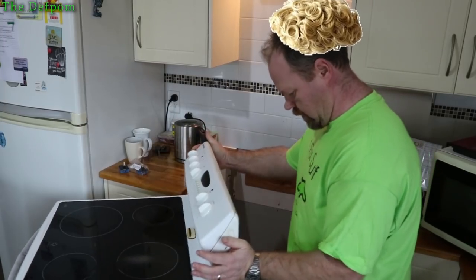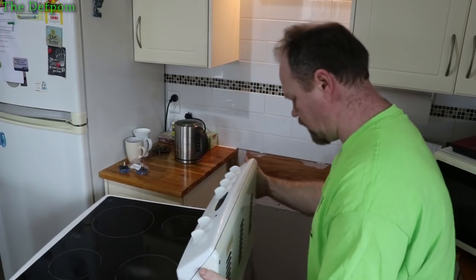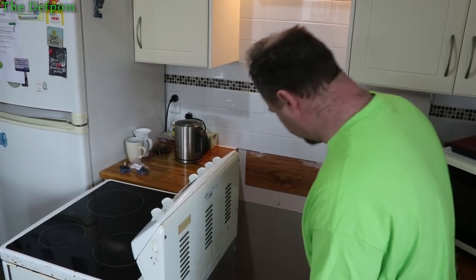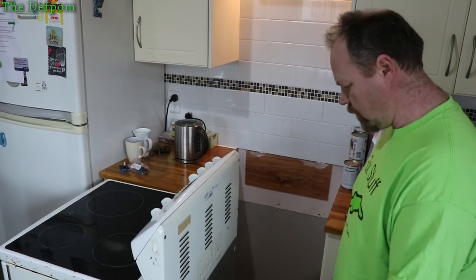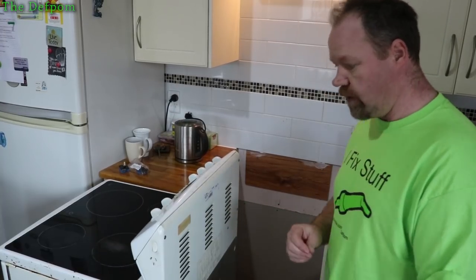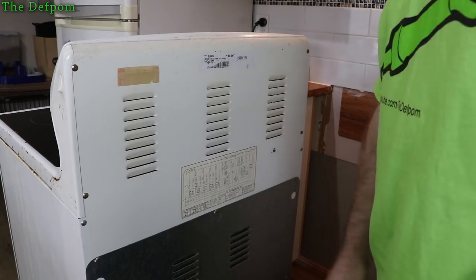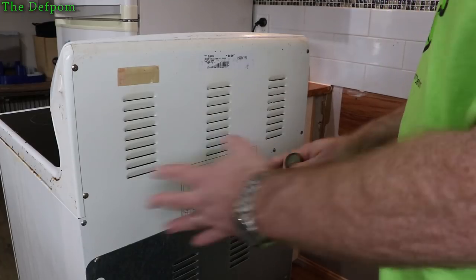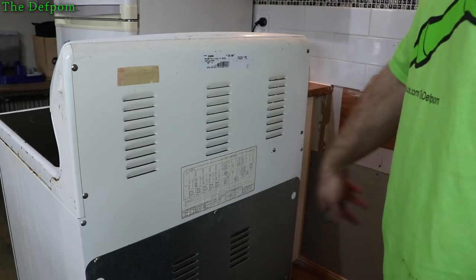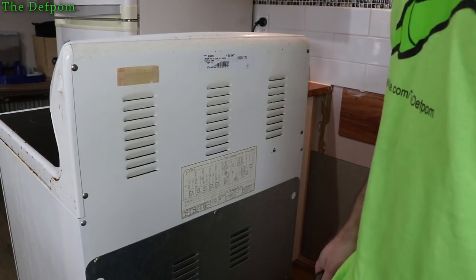We have to take off this top panel here. I'm going to get my multimeter as well, so I'll verify the power's off once we get this back off, and be absolutely sure we're safe. That's important. Now ideally you would unplug the cable that goes to the oven to make sure it's definitely isolated, but in my case it's really hard to get to that plug — it's right behind the cabinetry — so I'd rather just prove it's safe by voltage testing, and that's fine.